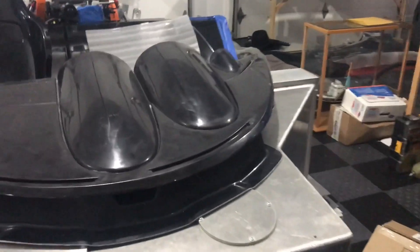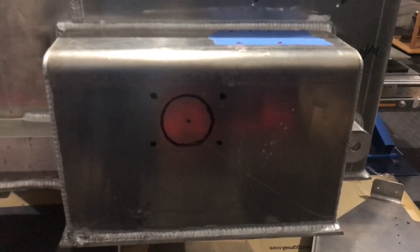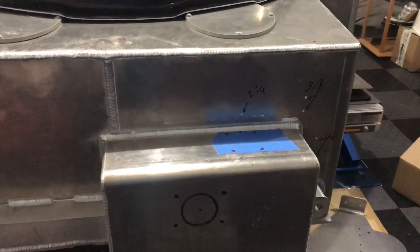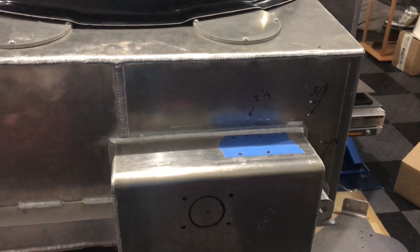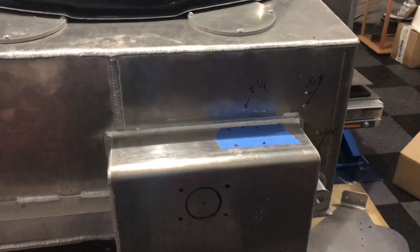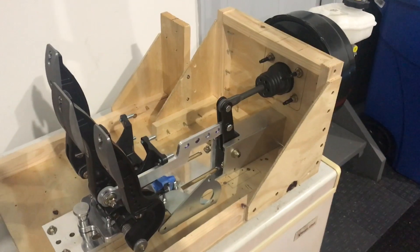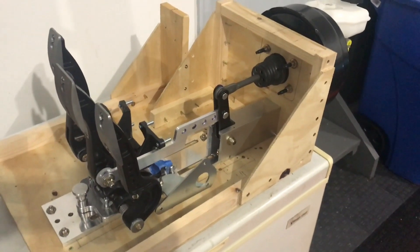Let's take a peek at the chassis to see where this is going to mount. I drew on the front of the foot box where the master cylinder is going to go per the current design. I'm not going to mount this right away — I need to install the suspension, then the body, which dictates where the dashboard goes. I have to put the center console in, which dictates where the seats go for final fitment. Once that's done, I'll install the master cylinder and pedal assembly. I'm glad I was able to check this off the list — power brakes were one of the important things I wanted to add to the super light coupe.